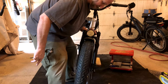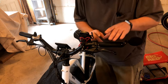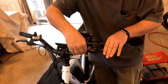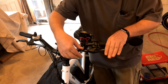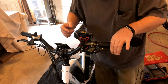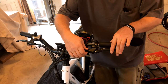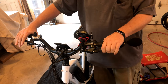Now I hear no brake noise at all. For the fine tune adjustment, I'm going to pull the brake back — it's too tight for me, I want it out a little further at full pull. So I'm going to pull this barrel connector out by screwing it counterclockwise, keep testing it until I get to about where I want it. Once I can fit a thumb through here at full pull, I'll tighten down the lock nut on that barrel connector and I'm done.